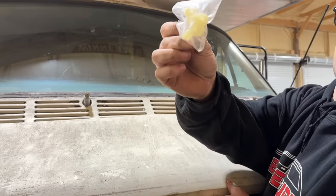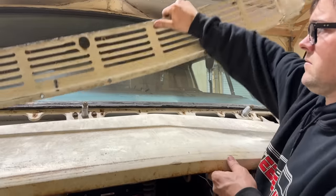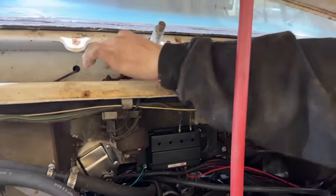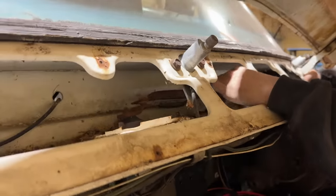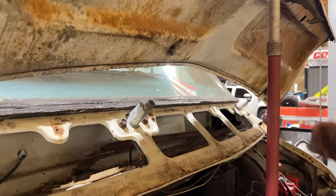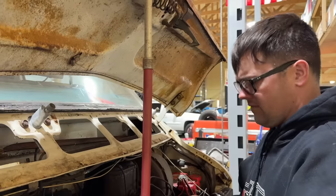See, we got these bushings off eBay. Tried to put them in the last video and it didn't work out. Okay, now we got some access. See, we got our electric wiper motor here, which we don't know if it works or not. It's got these plastic bushings and there's only one that's still hanging in there out of the whole group. Is this the second one? No, we got two that are hanging there. But the ones that are actually attached to the wipers here are not hanging in there at all. Hopefully we can pop these guys in, some fresh ones, and fix our issue.